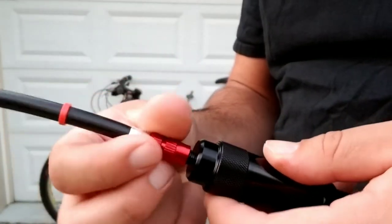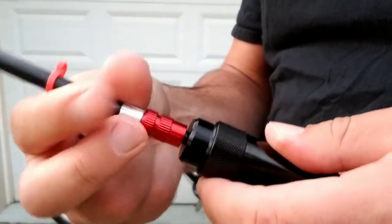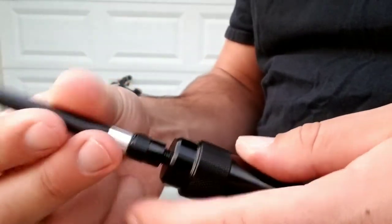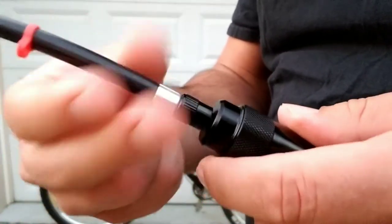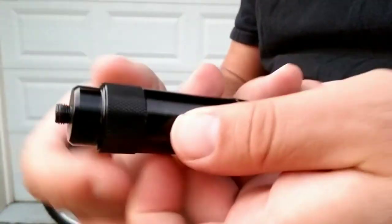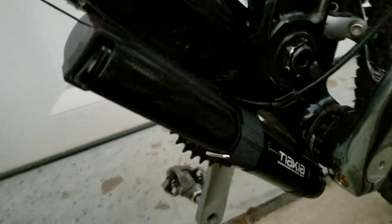What's nice is that either side just screws right into the pump itself. You can use the other end to attach to the bike, and likely what's easiest is to attach the hose to the bike first and then screw the pump into it. Here you can see the pump now installed on the bike — it's really simple. You're just going to use those water bottle mounts and the bolts that are included, screw it right in. Everything's pretty standard.